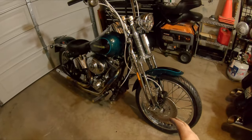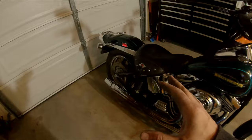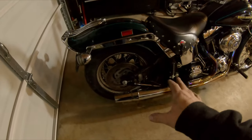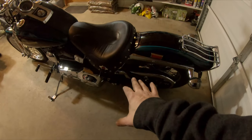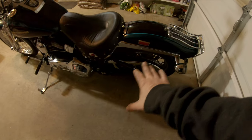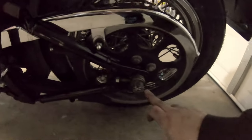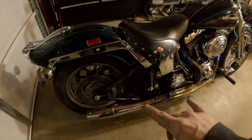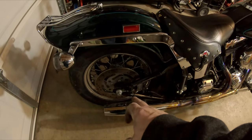She's back together. My buddy was here having some drinks and turning wrenches, and it's done. To recap what we did: got the new tire on and went ahead and replaced the rear brake pads because they were done — picked those up. Got the belt tensioned up — it's 5/16ths to 3/8ths over 10 pounds with the specialty tool. Made sure this rear tire was centered left to right by pulling a measurement from the swingarm nut center to the center of the axle on both sides. For me it worked out to 16 and three-quarter inches — once they matched, I knew the tire was centered. Then torqued the axle nut to 63 foot-pounds; it calls for 60 to 65.